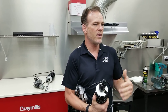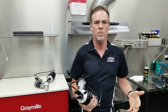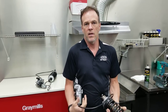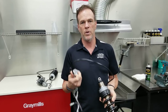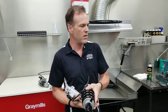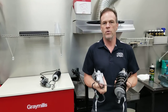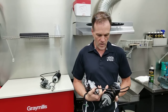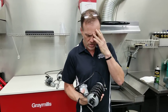This is an insignificant thing that you're not likely to feel while you're riding, but it's just something that as suspension specialists, we like to optimize while we have your shock off of your bike. And this system has air trapped in it anyway, so we go ahead and put an optimal brake line on it, or high quality stainless steel braided line. It's $50, and since we're bleeding the adjuster and putting clean fluid in it anyway, we figure that's a worthwhile upgrade. It lasts the life of the bike, and it will never give you any trouble. So we're going to show you how to install that.